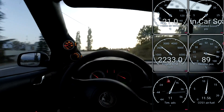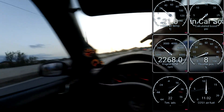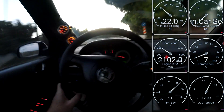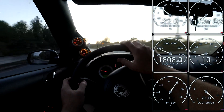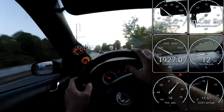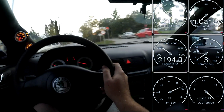I've also got it logging air fuel ratios because I want to see what it's doing between gear changes. I'm not sure if this dump valve is dumping to atmosphere or recirculating — I should look at the instruction manual to find out, or I might just put a camera there to see if it's opening or not. That's going to be a part two anyway.